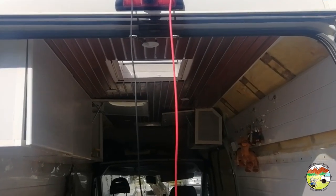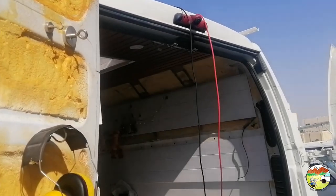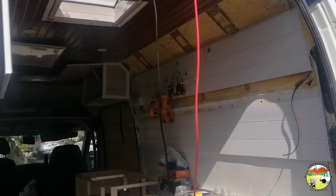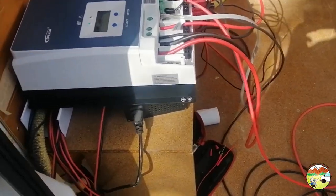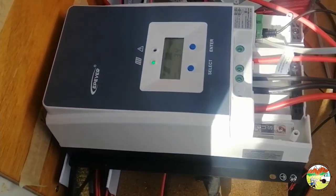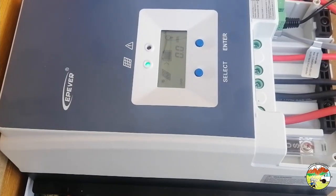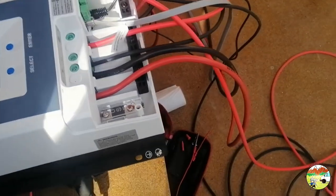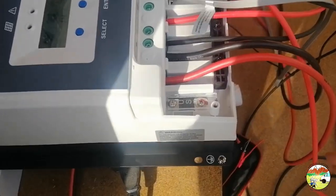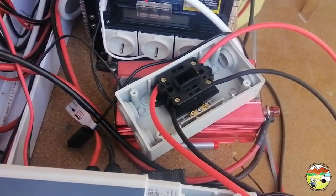While we were working with Liam, you would have seen us putting the panels on the roof. So I've just temporarily connected them because I wanted to test the MPPT charge controller. So it's now connected. As you can see, there's a green light flashing there. Not sure how well it'll show in the videos because of the frame rate. The cabling is a bit of a mess, but it's really just to test it. So we've got the solar panels coming into a double pole switch.